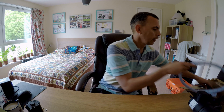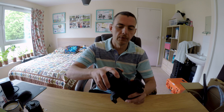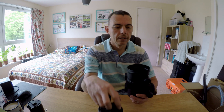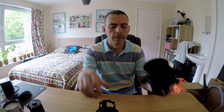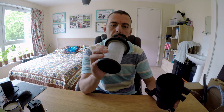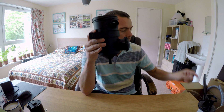And a clear hose. So how this works: the cap has a pressure release valve built into it. Unlike the Amazon can which was effectively empty inside apart from a splash baffle, this one has an actual filter element. As air from the crankcase comes in, it has to pass through the middle of the filter element — you can just about see the paper filter material. It's called a coalescence filter. The oil collects on the filter, the air moves through, and gravity eventually pulls the oil down into a funnel, through the exit point at the bottom, which connects to the clear pipe.